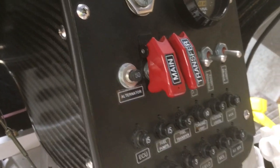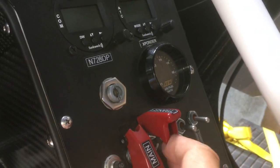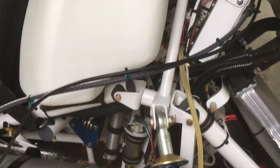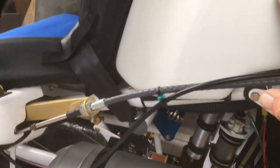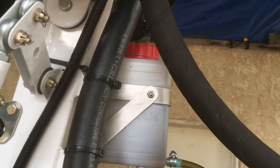Main power on. This latch here transfers fuel from the auxiliary tanks to the main tank. The way the engine is set up — because it's fuel injected, not carbureted — it has a pump that can only feed from one tank. So I have to move fuel from the two side tanks, which feed simultaneously through a low-pressure filter, up into the main tank, and then from there through a high-pressure filter I just replaced into the injector system. This little tank on top is the coolant — it's Evans coolant, which supposedly never needs to be changed and is not water-based. This big storage box has my ramps and a bunch of other useful stuff.